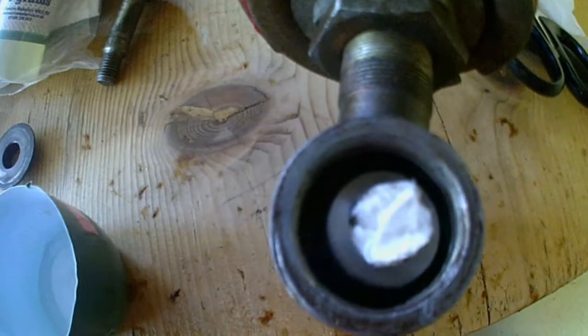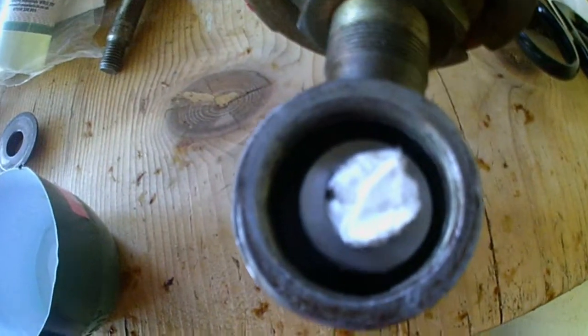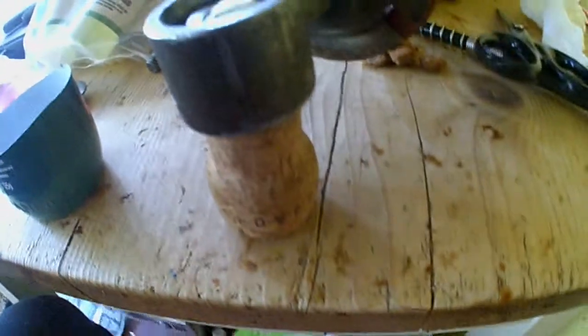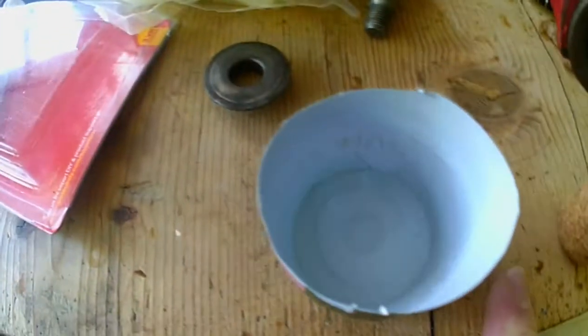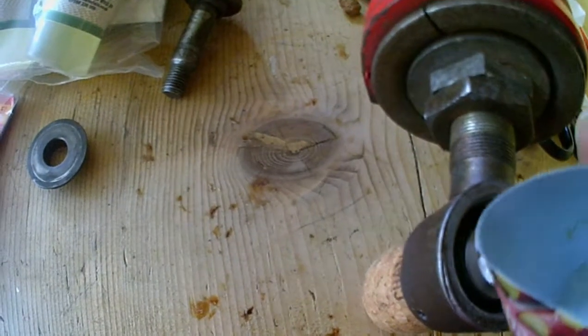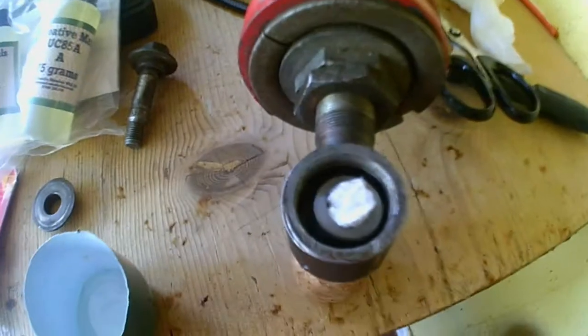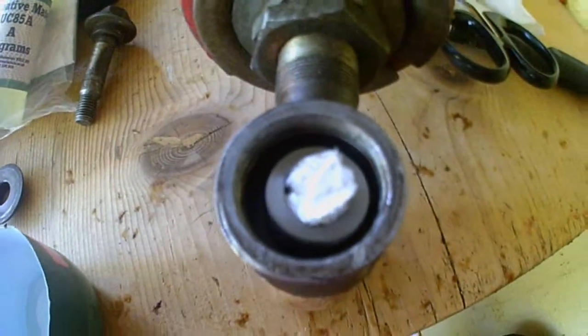Right, well, I've put the bush in the hole. I've filled the bush up with paper. I've used a cork at the bottom, and I've just got to fill it with the molten plastic to the right level, and hopefully my pouring will be accurate enough. It's going to be an unfilmable thing because I don't have a tripod, so let's go.